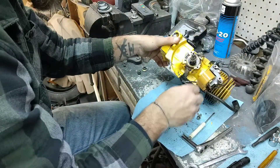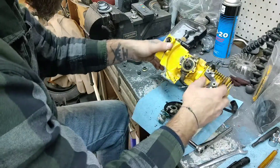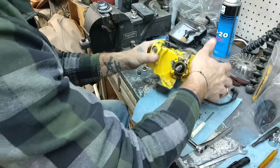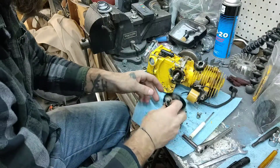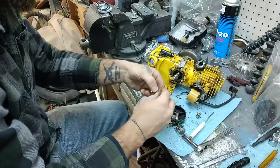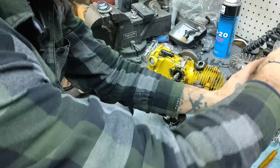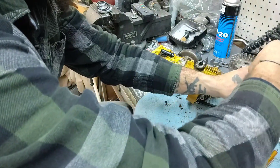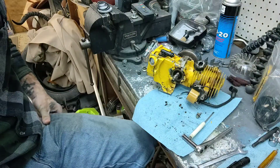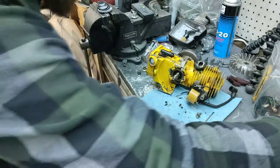I got that pulled off. Got our little felt gasket that goes back behind there. It looks like our crank seal was leaking a little bit, which is pretty expected for an older saw. That's why I ordered it — not only because I'm doing a total rebuild on it, but these old saws they tend to wear out like that. Especially these iconic 10-10s. Everybody loves the 10-10s.